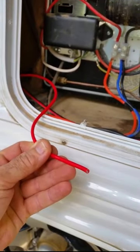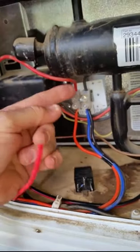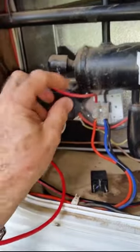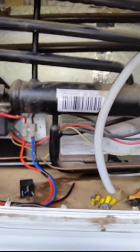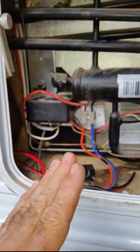What I'm going to do now is run larger diameter wire directly from the battery compartment, out here, through a 30 amp automotive relay, and straight up into the fridge heater element. I'll use the switch from the top of the fridge to activate the relay. In effect I'll have about a two metre run of cable through a fuse holder and straight up to the heater element, delivering maximum voltage at the highest current demand. I've already tried this with a power supply and the fridge works great.